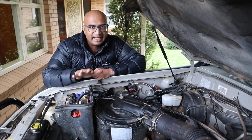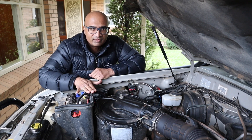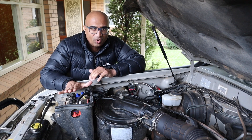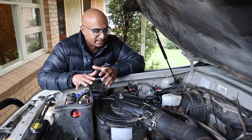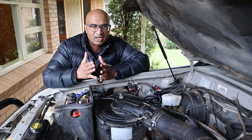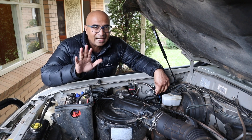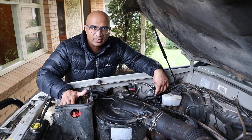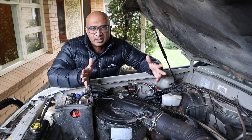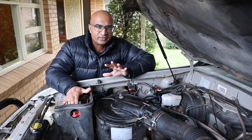This is what I'm going to get installed in my 80 Series. Currently I've got a dual battery setup: out of the camera's frame at that end I've got my cranking battery, and over here I've got my deep cycle battery which supplies power to all my accessories — fridges, floodlights at the back for camp setups, and so on. Managing these two batteries is a simple solenoid which distributes the power from the alternator between the two batteries and isolates the main battery when the engine is switched off.